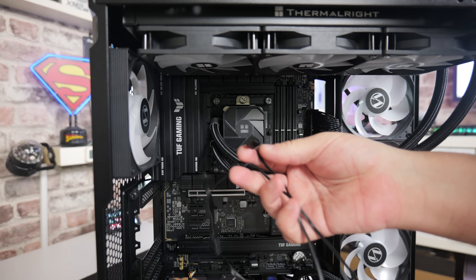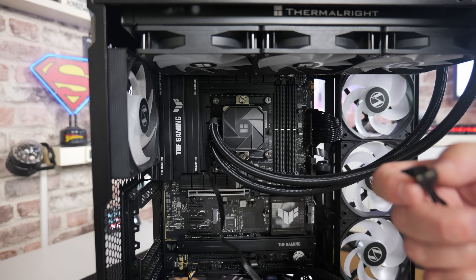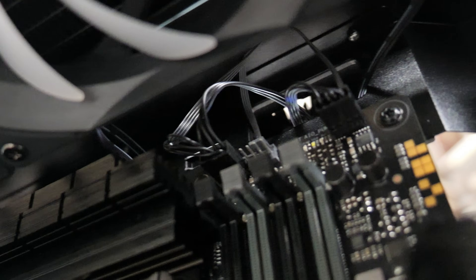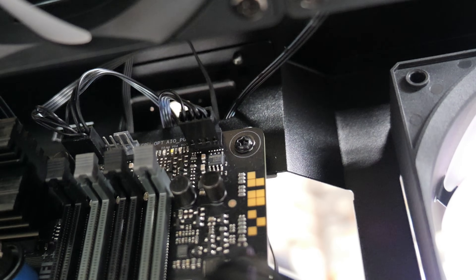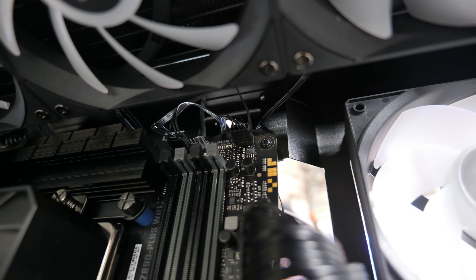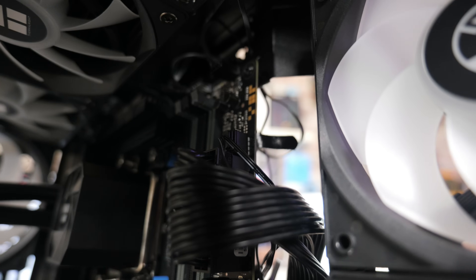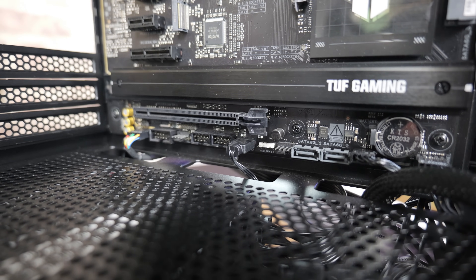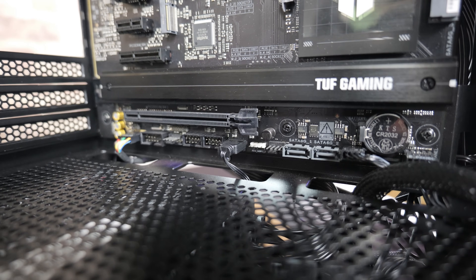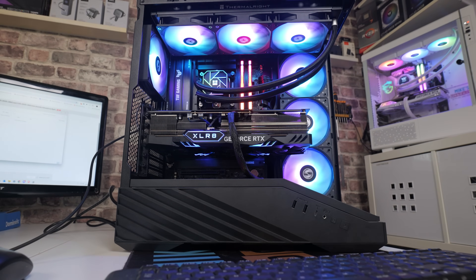With the pump cables, you'll have a PWM and addressable RGB. Just pass those through however you see fit and connect them to the ports on your motherboard. We've got the CPU fan header for the radiator fans connected at dead center, CPU optional which we've left blank, and the next one along is the AIO pump header — that's the main connectivity. To the side there is the addressable RGB plugged in for the pump itself. Down at the bottom I'm using one of the additional headers on the motherboard to connect up all the RGB for the fans. That should be pretty much everything — there is the Thermalright Aqua Elite V3 360 installed with our Intel processor.